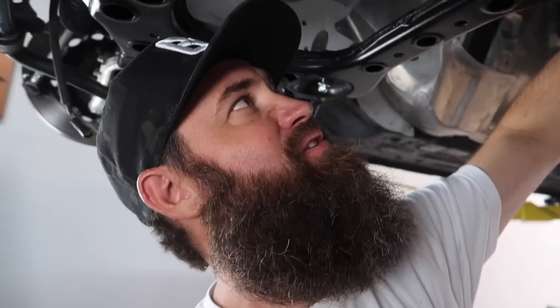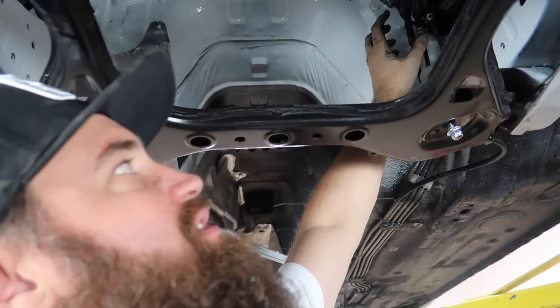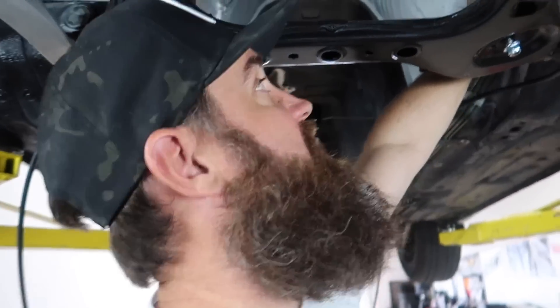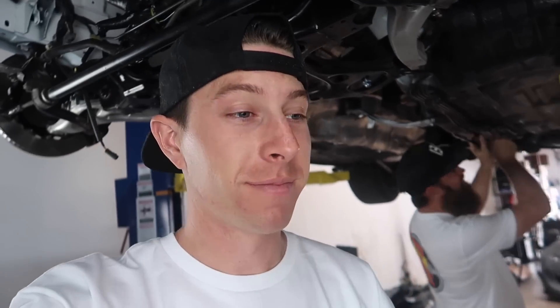Let's show you something while we're under the car real quick. See these here? These are fuel lines — these three things. This is what delivers the fuel to your engine. We need to remove these rubber lines, flare these ends, and put fittings on the end of them before we can put the engine in. Do you imagine trying to work on these while the engine's in the car? You can't do it. Once these are done, the engine goes in. Trust me, I'm pushing this — I want to say screw it and put the motor in.